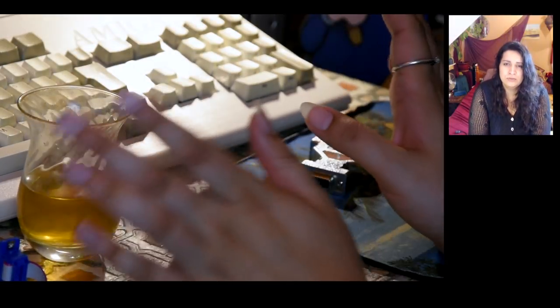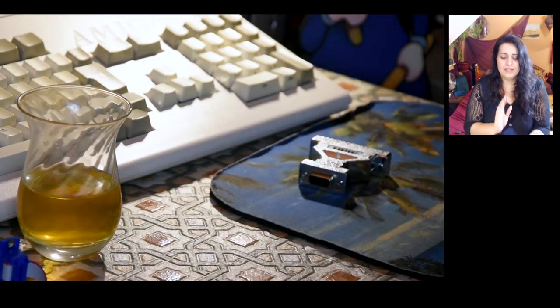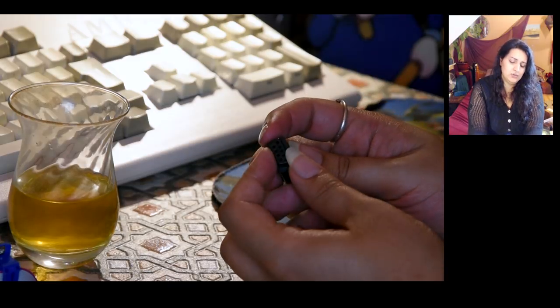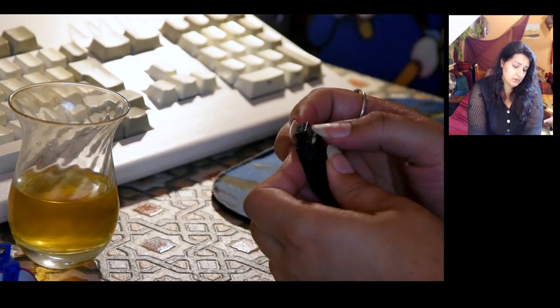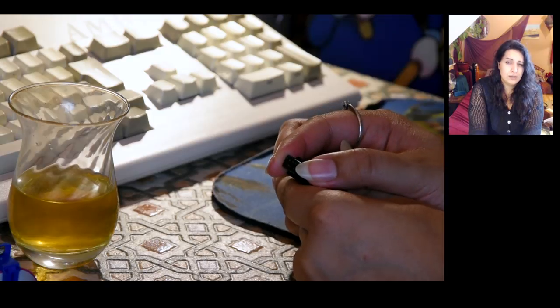Okay, so as a general rule, what I know about the Amiga is that, with regards to these DB9 connector plugs, hot plugging a joystick or mouse that has a plastic plug, with no metal shielding, as far as I know, that's okay.